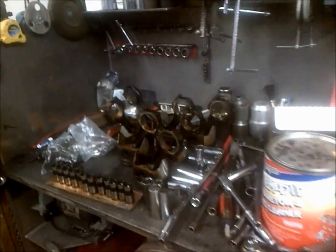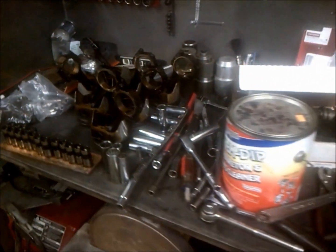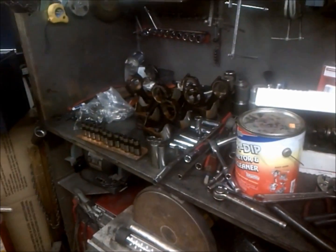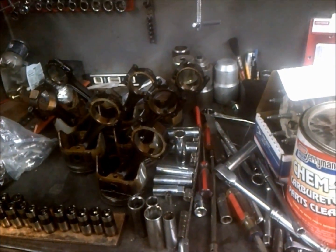So far they're good — there's no wrist pin play. If I hold it down and lift up and down I can't feel any play in there, so hypothetically those should go in just fine. You always want to scribe your pistons so they all go back into where they're supposed to go. Because it's from the factory it's a balanced rotating assembly, so you want to put it back together the way it was so it stays properly balanced.